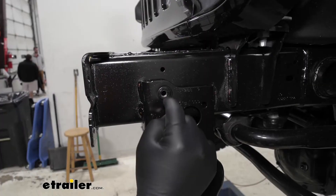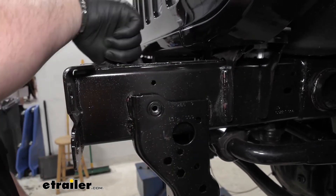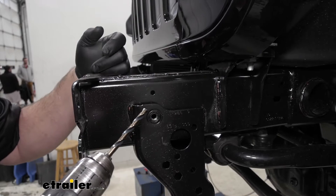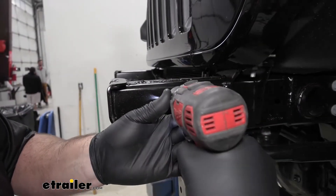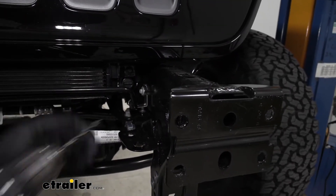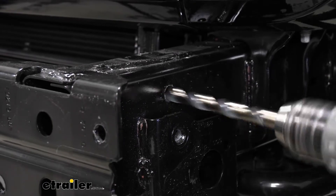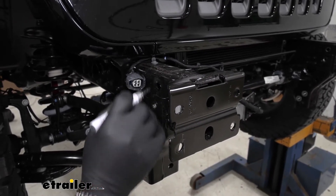Then we're going to remove the bracket. This bolt that we took out — right above it you're going to see a hole in the frame rail. We need to open that hole up to a half inch, and that half-inch hole needs to go all the way through to the other side. I'm going to start with a small bit and open it all the way up to a half inch all the way through the frame rail. This one happens to have a hole on the inside also, so I'm going to do this side and then come over and do the other side. We're going to need to do this on both frame rails. Now I'm taking a paint marker and covering up that bare metal — it's going to help reduce the risk of rust and corrosion later on. I'm going to do that with each one of the holes.